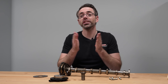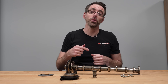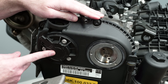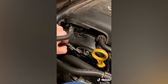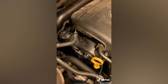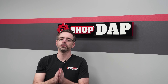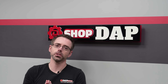Diagnosing this issue fortunately isn't terribly difficult, but the symptoms can start with noises. If that noise is coming from your upper timing cover, you can try unplugging your cam magnet and see if the noise changes — as you can see, the noise is completely gone. Also, if you hear that noise coming from your engine, please make sure your engine has oil in it.